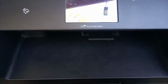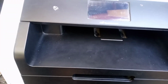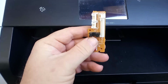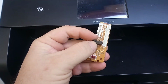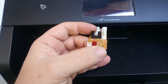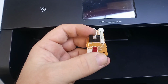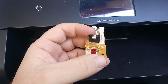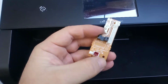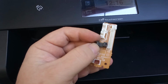Now, you being the owner of it, you'll be testing it and using it and making sure it works okay. For those of you that own printer repair workshops, sending the printer straight back to the customer now is a risky move. So if you're not familiar with how these devices work, the infrared sensor in there is a lot similar to an old CRT picture tube. As CRT picture tubes age, their emissions drop, the screen becomes duller and duller as a screen gets older, and the same happens with the infrared sensor in this. As it gets older and older, its sensitivity falls.